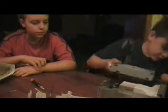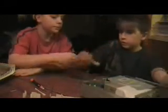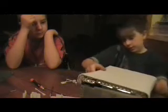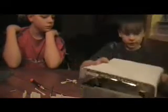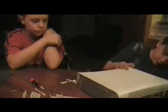Then you just slide this back and make sure you work it in there good. You don't want to put the disc tray open piece on yet — you put that on last. This is the hard part: you've got to find all the way around it. See all these little tabs on this Xbox? Those little tabs around it bend really easy because they're just little aluminum pieces — nothing too sturdy. You want to get all those straight and make sure they're all in there perfectly snug.